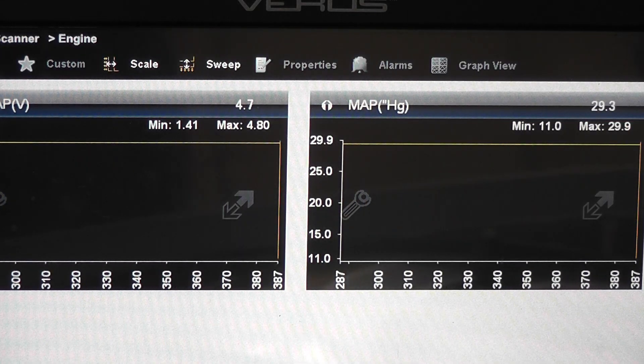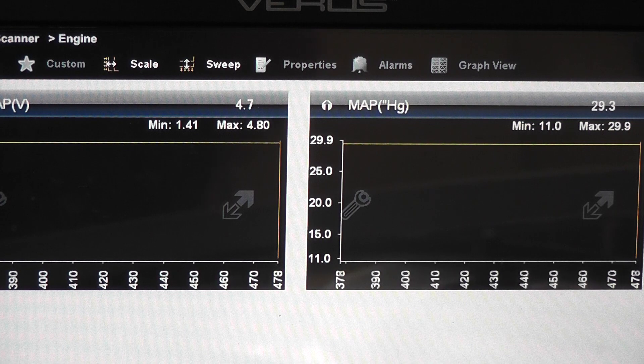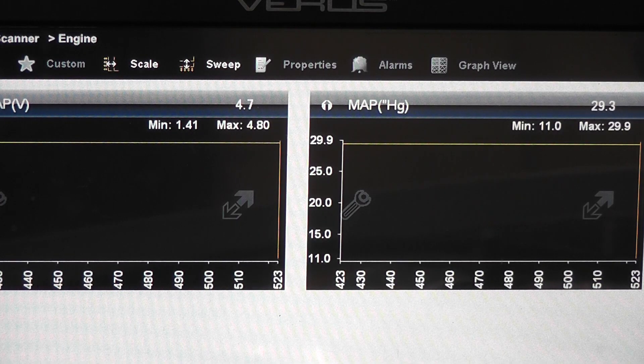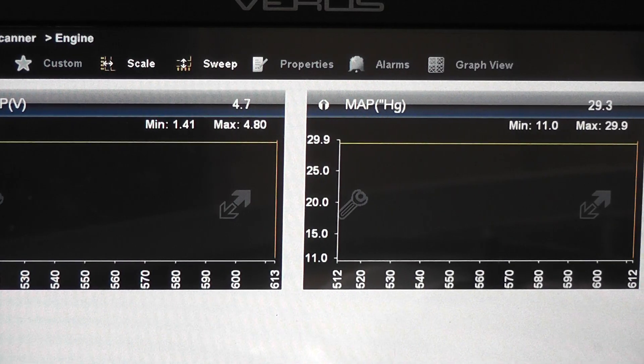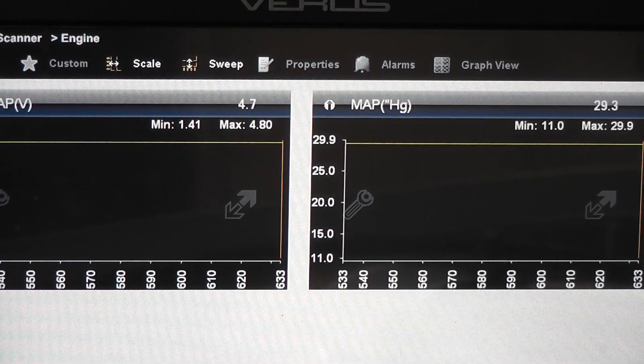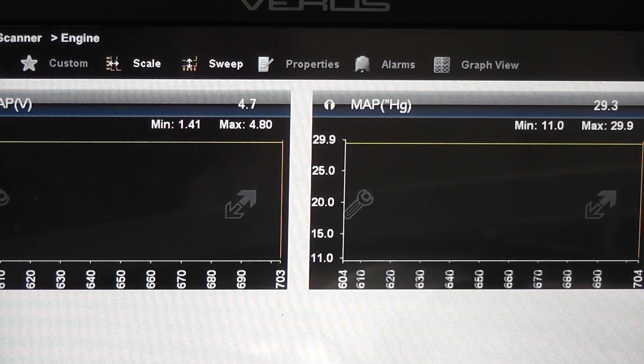Just to rehash — we used scanner bi-directional controls to identify it, energized it ourselves, and identified it by looking at EVP voltage, MAP voltage, and whether or not the idle was getting rough. That was the key: how rough did the idle get? A lot of people think EGR flow gets a little bit rough and you're good — no. The engine needs to get real rough and just about stall. Some cars won't stall, some will — as you see, this car stalled as soon as we energized the EGR. The scanner bi-directional maybe didn't open the valve as much as using the jumper wire, because I'm going from zero to 100% open with a jumper wire, whereas the scanner goes in increments and the computer can compensate. EGR flow P0401 trouble code on any GM 3.1 or 3.4 engine — same exact place, that's where they go bad. Don't change the valve for a flow code on this design. Clean the passages.